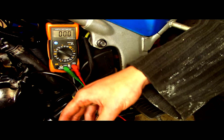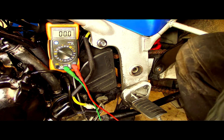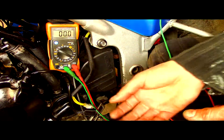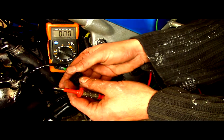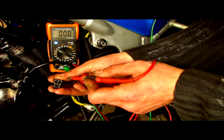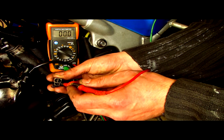I've set the meter up — hopefully you can see it there. We're going to run the test with the engine on. We'll put the common probe on the negative side of the battery — use a crocodile clip or wedge it in there somehow. Then with this block here, the one that comes out of the top of the stator — the one with the three phases in it — we're going to test across each phase, just like this, and look at the voltage. Each single phase should have roughly the same voltage on it, so we're looking for about 23 volts AC.